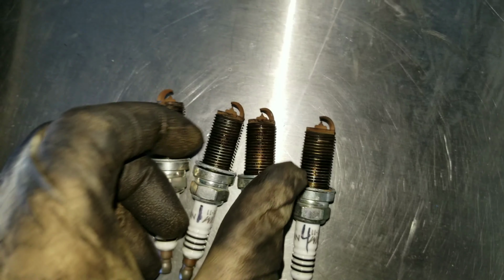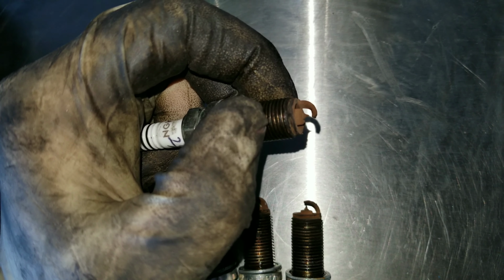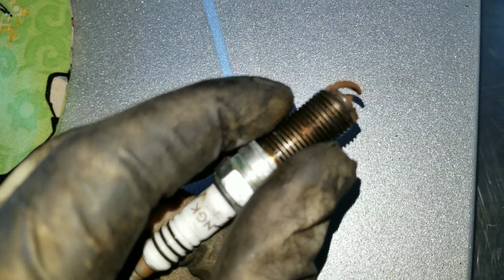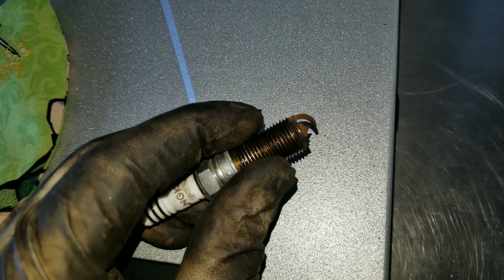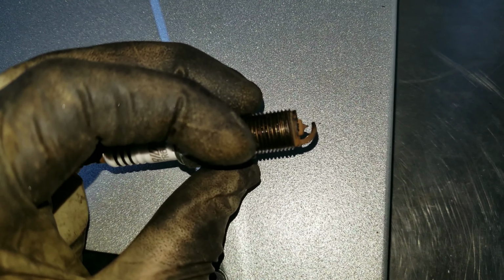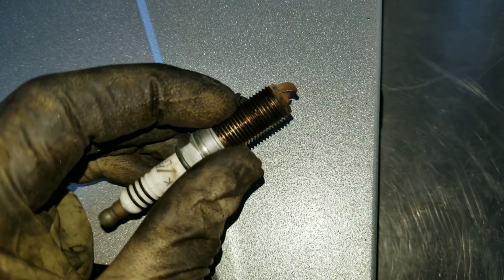As I started doing pulls, I quickly developed a misfire, and I figured it was probably just to do with plug gap. Certainly these plugs are definitely worn, but look at how much deposit is on these after just a few pulls on the dyno.